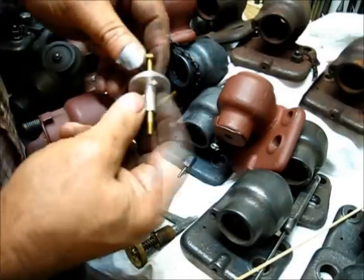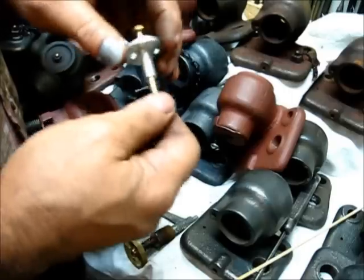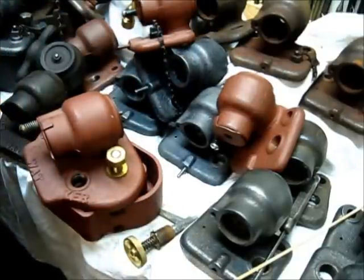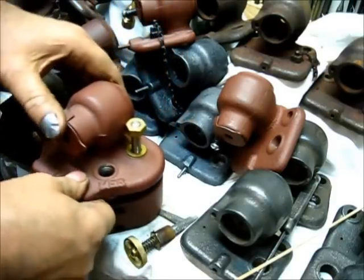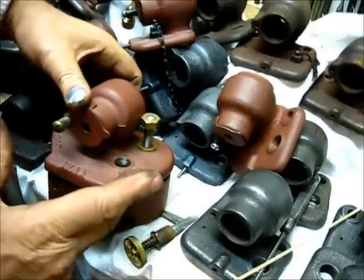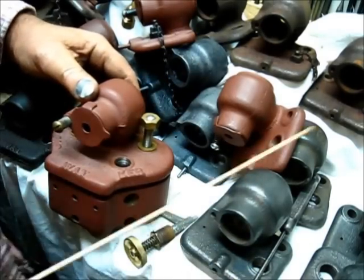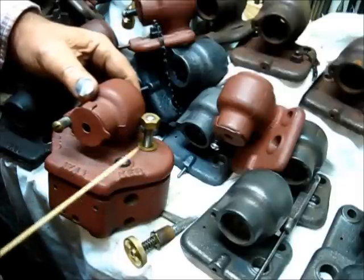If you have one in this condition, it's time to replace it. It should be a good sliding fit — I'm going to say maybe four thousandths clearance, maybe four thousandths. Mixer tops, there are several variations. This is one variation of three. This had three: kerosene, water, gasoline. When you run only gas in the engine and don't put kerosene in it, then this becomes your primary needle valve.